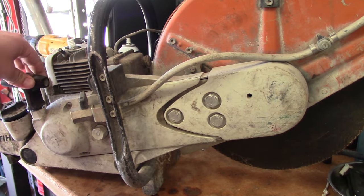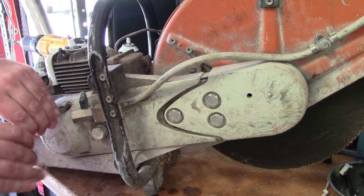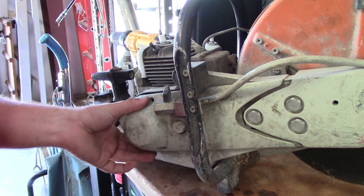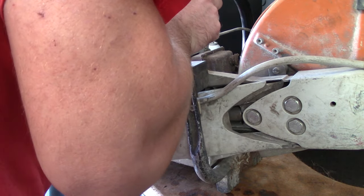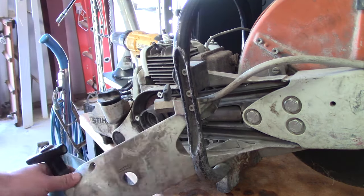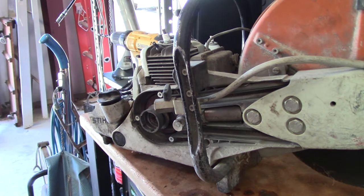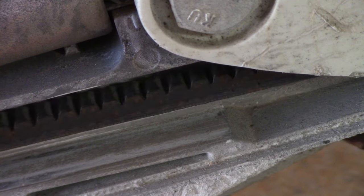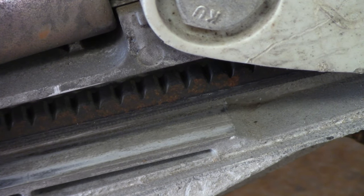Seeing that I'm at a stopping point with the carburetor and I've got to order parts anyway, I'm going to check the state of this belt because some of those kits come with a belt. So it's a good idea to see if I need to replace it. That comes off easy enough. The pull cord, like I said, is a little frayed and needs to be replaced. The belt's actually in okay shape — decent shape, no cracks. Looks like it's been replaced fairly recently, so we'll leave that. But that pull cord does need to be replaced.